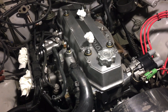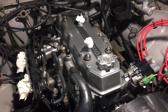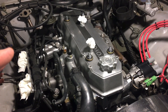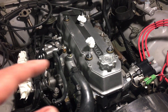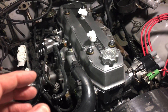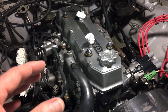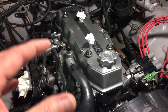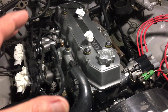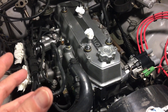So I had to go back and run the numbers. I discovered that having the valve lash involved while setting cam timing was purely my mistake. Inadvertently, instead of five degrees retarded, I set the cam to approximately five-and-a-half degrees retarded. It's not enough of an error to warrant resetting the cam timing at this point - I just want to get the motor fired up - but it is something worth mentioning.